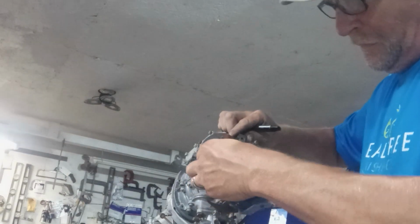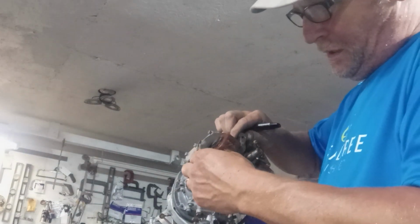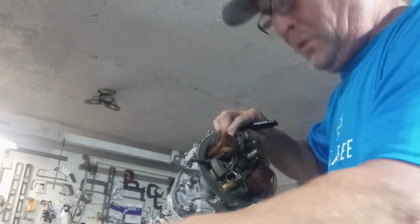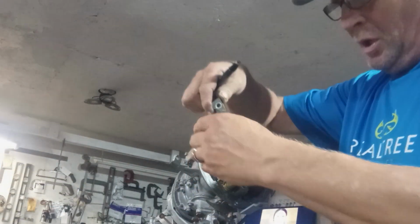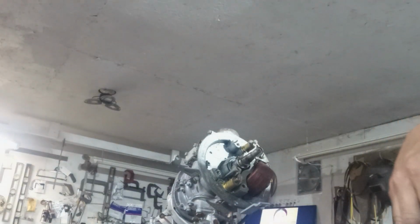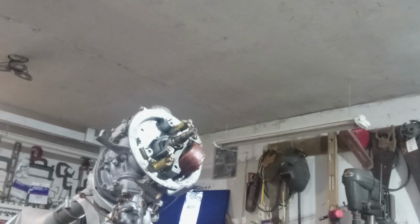Okay, there's pins, I see. There's two pins that locate the proper position. I was wondering how I was going to get my coil spacing correct. Well, if you look here on the bottom of the mag plate itself, there are locating pins, one here and one here. So these coils don't have an air gap adjustment for this motor.